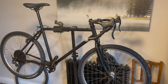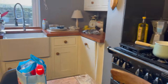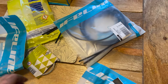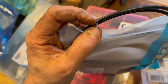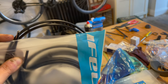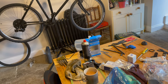So that's the levers and the bar end shifter on. What I'm going to do now is just cable it all up with the outers. Now if you're unfamiliar with cable outers and don't know the difference: if you look down one cable you can see it's a coil — that's used for brake cable. If you look down another one you can see it's loads of strands — that's what we use for gear cables. I'm going to make sure we have cable end caps on each of the ends when I put them on the bike, get them in place where you want your cable runs, and then we can put the inners in.